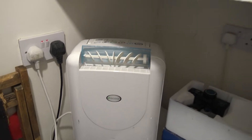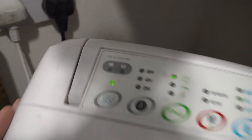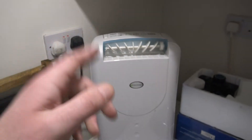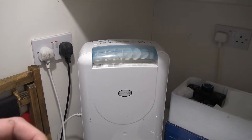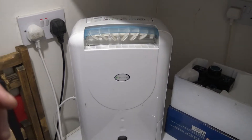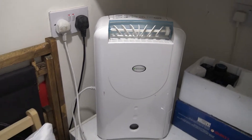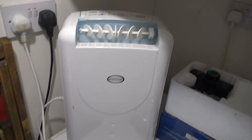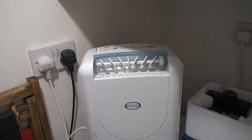I'm sitting here thinking - this unit has got a problem button, a little exclamation mark. This is a DD1 Classic Mark 5 by the way. If there's a problem with it that light comes on to let you know. There is a problem because it's not collecting any water, so why isn't that light coming on? The heater doesn't seem to be getting hot, so why isn't the light coming on to say the heater's got a problem? Obviously that problem light circuitry isn't very good. Normally they collect water really quickly - it was really good when it was new but it lasted about 5-6 months.